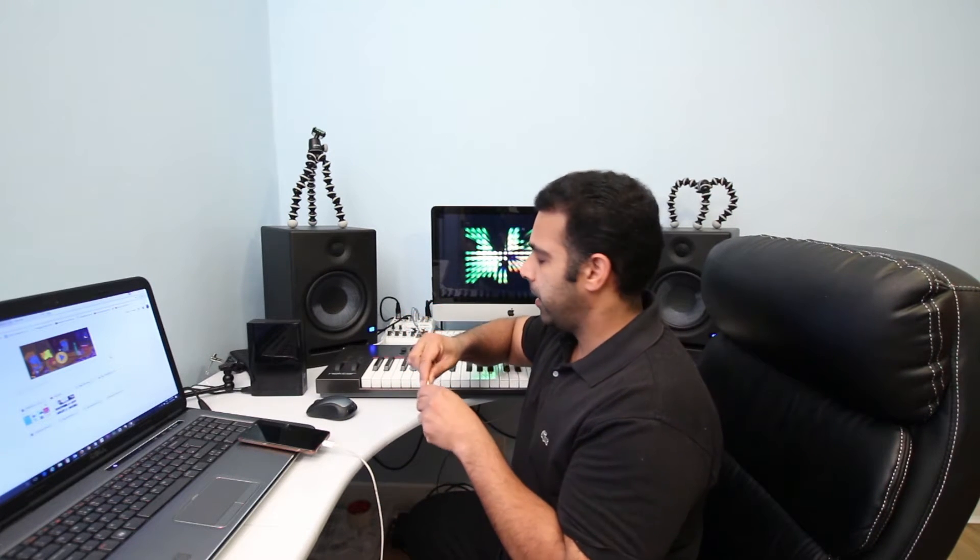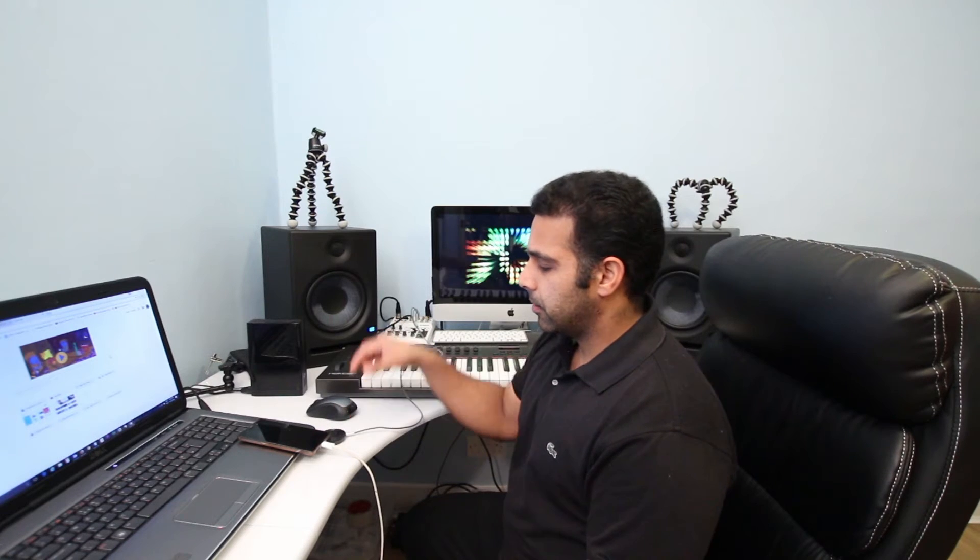The second method is to get a small amplifier, output from that amplifier to your left and right speakers, and connect a 3.5mm cable to the Chromecast end. Whatever input the amplifier takes — XLR or TS — convert the other end of the cable to that. If the amplifier supports bridge mode, always put it in bridge mode: it combines channel 1 and 2 power and outputs to left and right speakers.